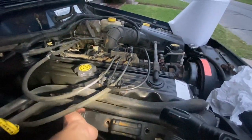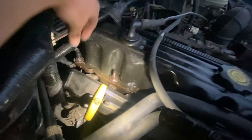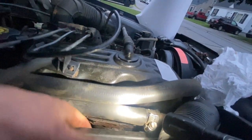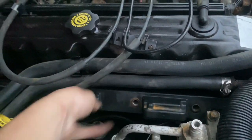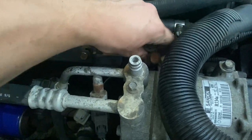You need to get all six of them aligned at once, so just be patient here. Count them off — one, two, three, four, and all six. Now push this down and make sure it's contacting all six of the spark plugs. Take the four bolts from earlier and drop each of them into place.